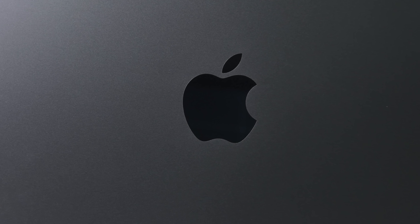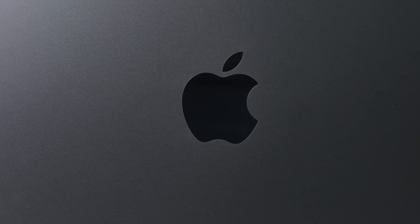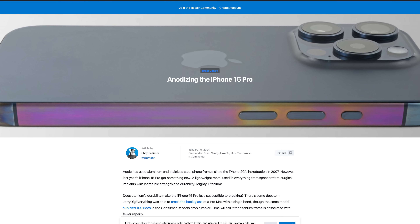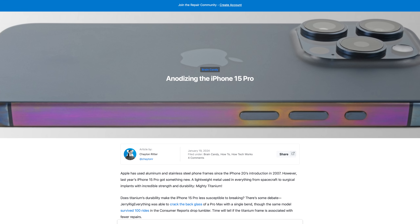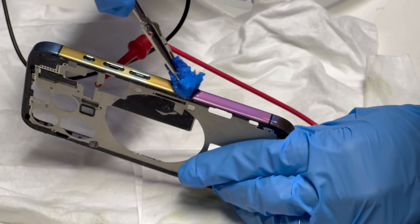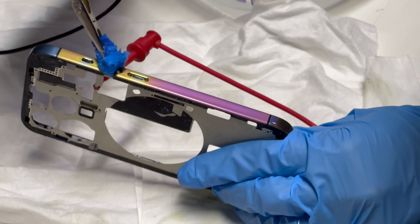The controlled corrosion eating away at the surface created the matte space black finish. We're seeing the same bumpy finish on the iPhone 17 Pro, infused with the orange dye. Not all metals can be anodized, but both aluminium and titanium can. In fact, one of our engineers went ahead and anodized the titanium-framed iPhone 15 Pro — we have an entire blog post about the process, link in the description. Apple is probably using an immersion bath, not wiping the frames with a kitchen sponge.